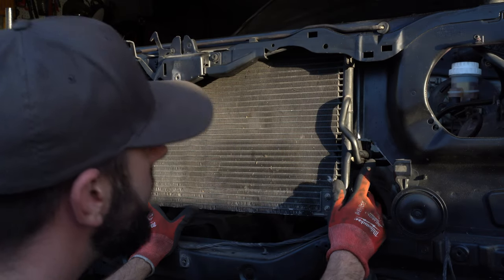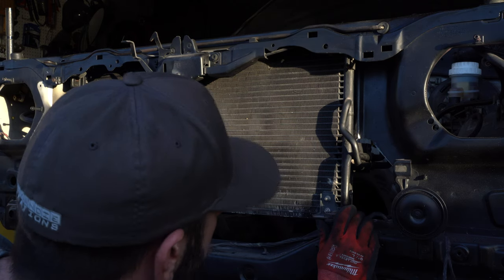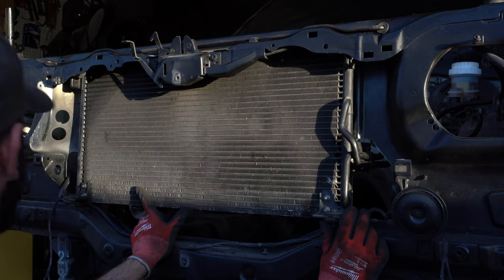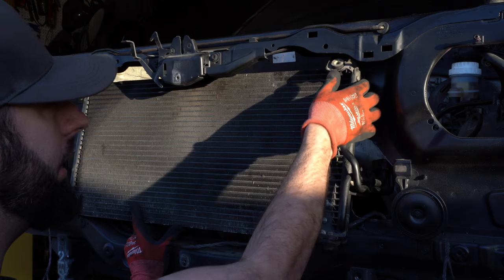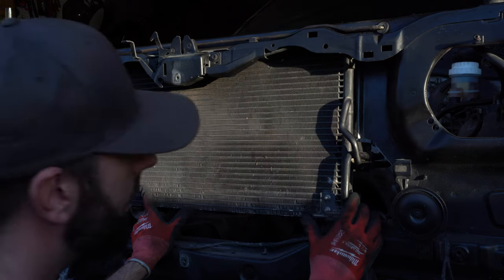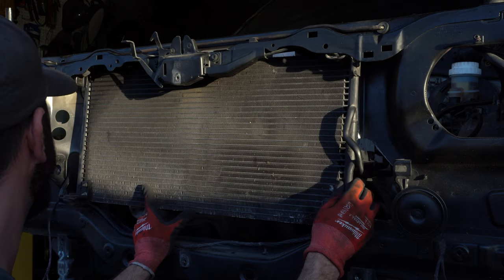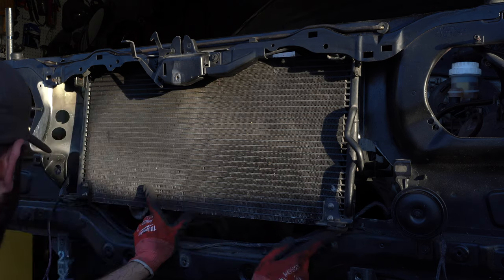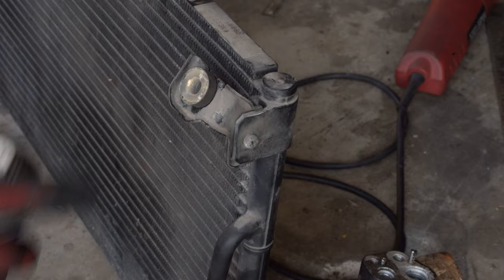So I've opened up this hole so that I can move the condenser up a little bit, and man, I know I keep saying it, but I am stoked at how well this condenser fits. Oh, it's almost like it's made for it. See, it's got some mounts at the top that are kind of at a 45 degree angle, but those could almost bolt up to the existing metal on the Mighty Max. I'm gonna try to cut these and twist them so that they're vertical, and I might be able to just drill some holes and mount them directly to the top. And if I can do that, making some mounts for the bottom, it's gonna be so easy. Oh man, it's another good day.